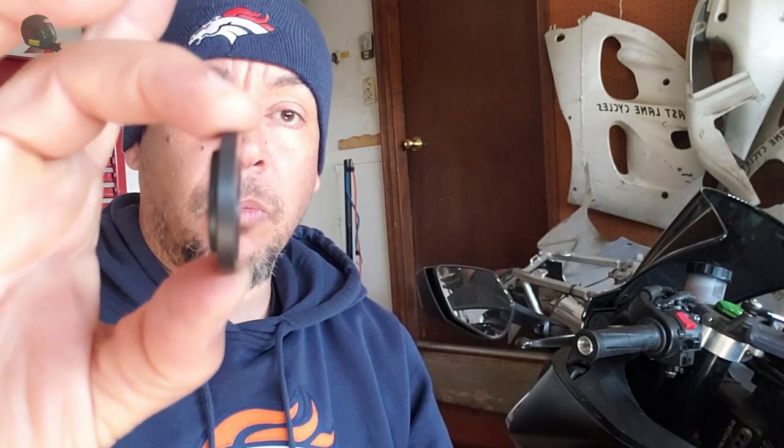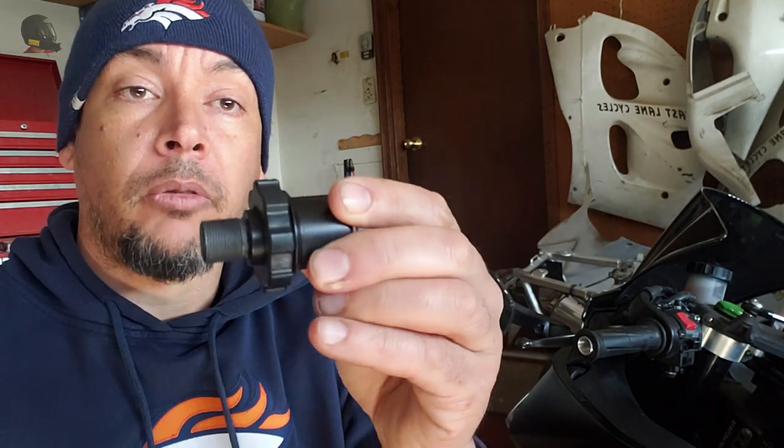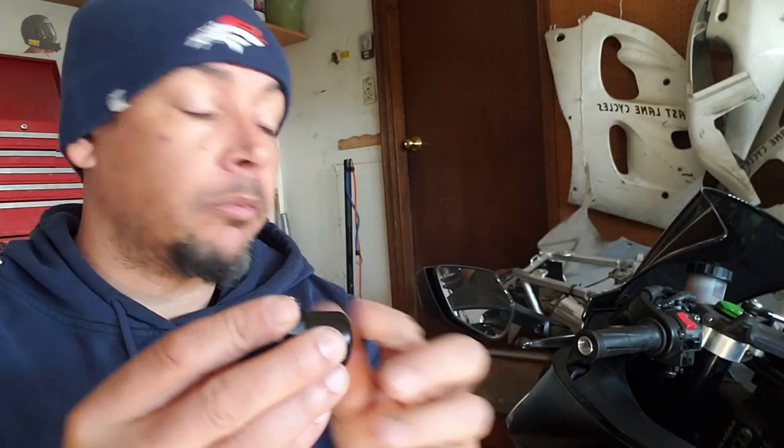You've got three different thicknesses. I went ahead and started with the thickest one. I installed the throttle lock into the bar end and found that before I could bottom it out and torque it down, it was already rubbing against the throttle — the throttle was essentially locked in position and you couldn't turn it. So the thickest one, at least for the 2015 ZX10R, is too thick. I tried the medium size and the thinnest one, and the medium size seems to work the best.